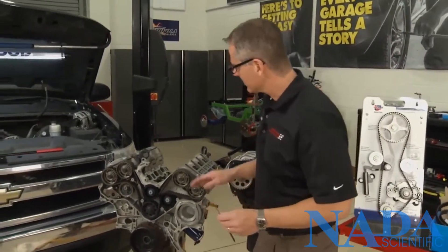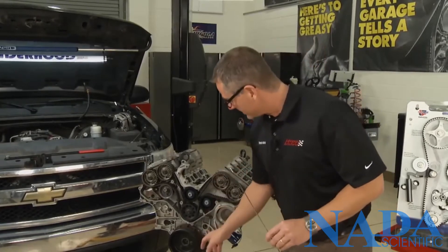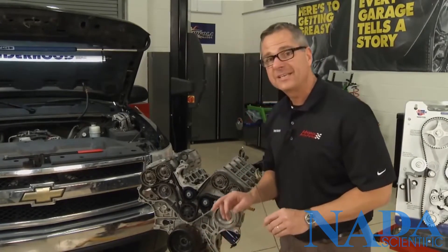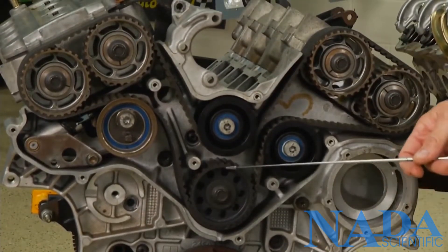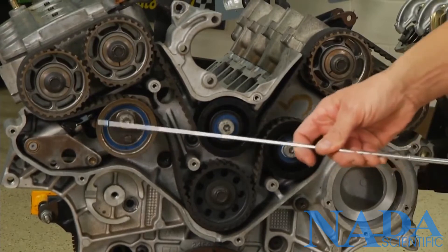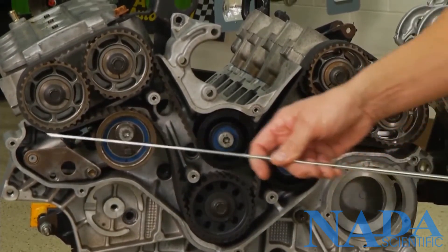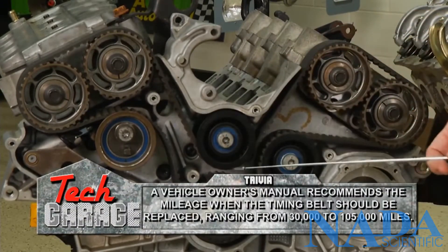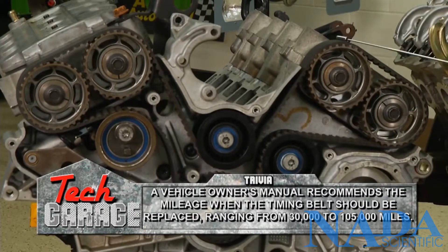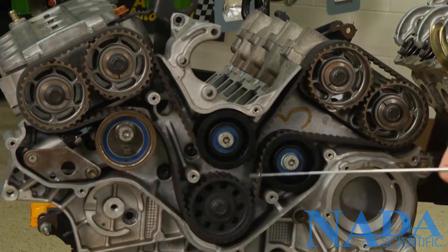This one's a little unique because it's a dual overhead cam, and not only that — this is a 3.4 liter and it employs an actual chain down here that drives the intermediate shaft, which drives the timing belt. You can see it here: this is the intermediate shaft, then the timing belt comes up through the tensioner located right here, then it goes through two camshafts — this one here is the exhaust camshaft, and the intake camshaft comes over a little idler pulley to the intake and then over to the exhaust camshaft, rides back to an idler pulley, and back to the intermediate shaft.